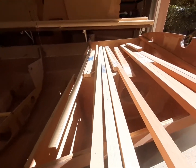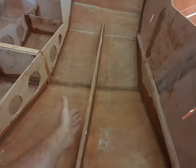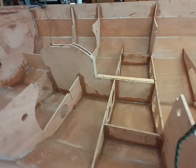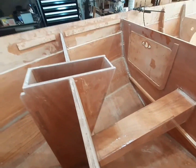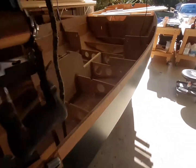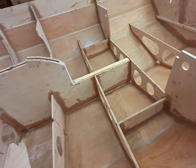The next part is to put all these cleats — the bulkhead cleats and motorwell cleats. They go on every bulkhead to help with the placement of the floorboards. I'm going to go ahead over the next day or two, pre-fit all those on all the bulkheads from front to rear and get those glued in place. After which, I'll finish sealing all the underside below the floorboards and get it ready for actually installing floorboards.